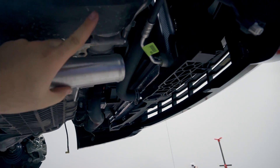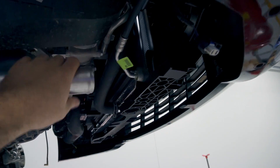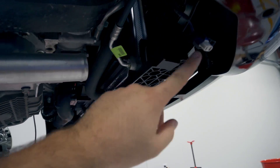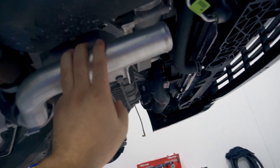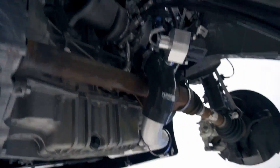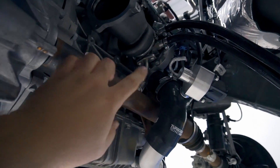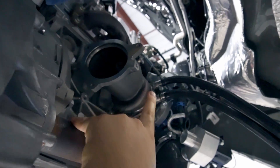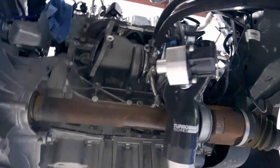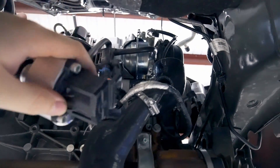At the factory outlet you can reuse whatever boost hose you had before — factory or aftermarket like a Whoosh. There aren't really other couplers that replace the factory piece, but it is required for this kit because the outlet is in a different spot. From here it's just throwing everything back together — intake tube, downpipe, O2 sensors — and connecting the oil feed line. Once buttoned up, flash a base tune from your tuner, get your data logs, and start tuning.